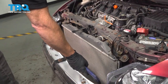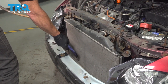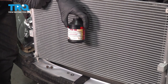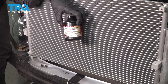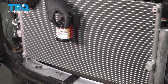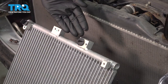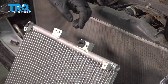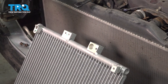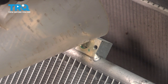There it is. Now let's clean down the area — I'm going to carefully use some compressed air, but not blow directly at the fins because I do not want to damage them. Now we can prepare our brand new AC condenser for installation. Make sure you have some PAG oil — that's special AC oil that you need to use inside of the AC condenser. Let's get one ounce of this and put it directly into one of the ports. Carefully stand the AC condenser with each of the ports upward, remove the rubber plugs, and put in one ounce of PAG oil directly into the port.